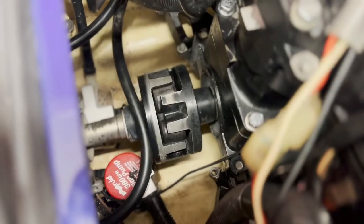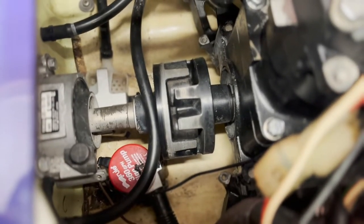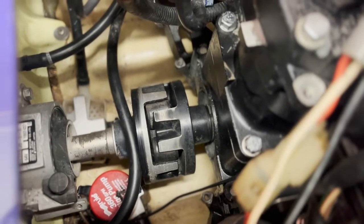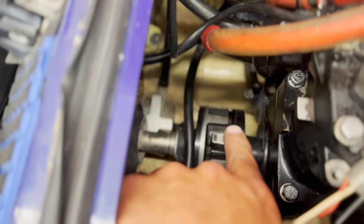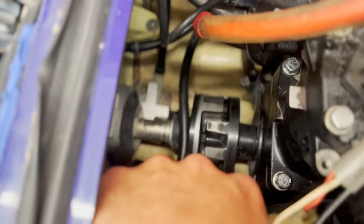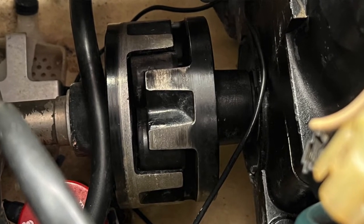Here's what it looks like on my ski now. The gap is questionable — it's not horrible, but it definitely needs to be a bit tighter. This coupler needs to come forward from the mid shaft, and that gap needs to be a lot tighter. Really the only way to fix this correctly is to pull the motor out, remove the whole mid shaft assembly, and using a press, push that shaft forward just enough to make up the difference.